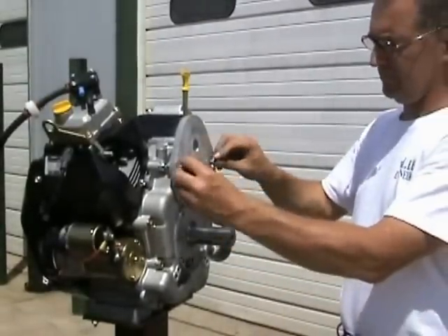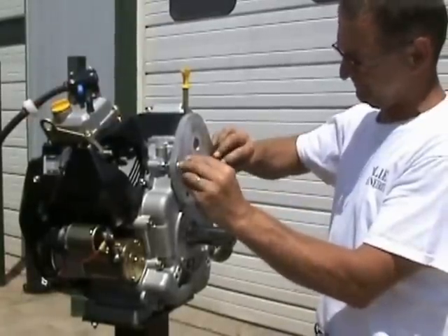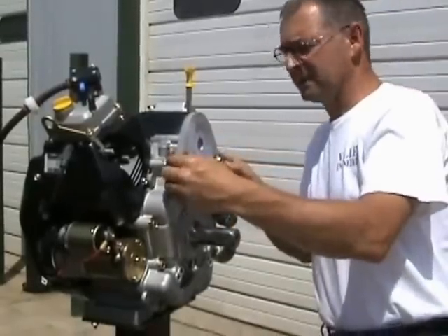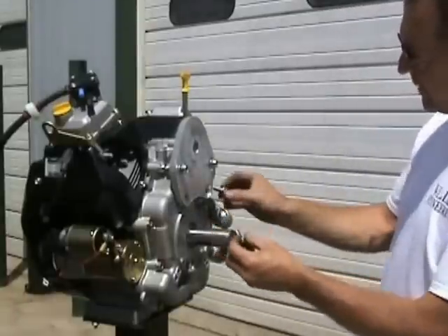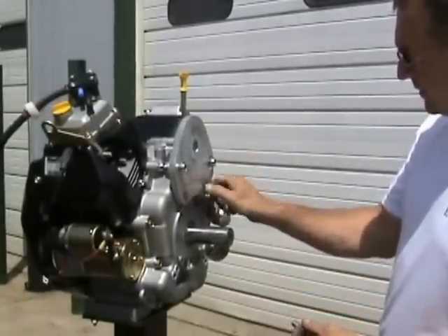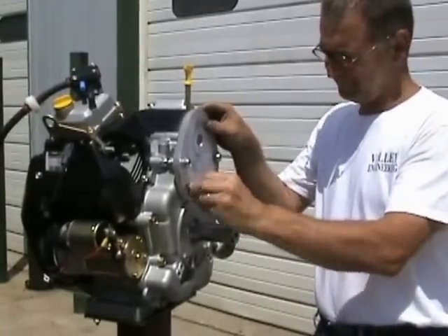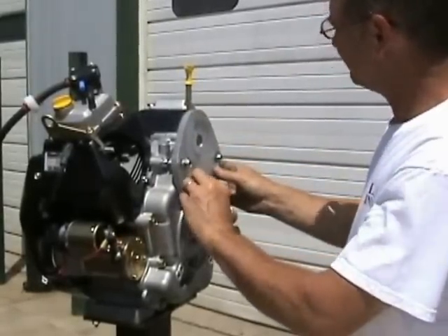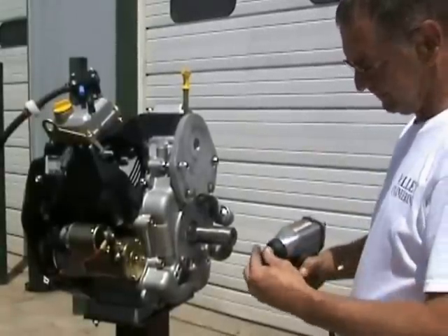Next step: another set of washers, and this time the locking nut's on the outside. I run the non-locking nut in a little bit extra so the bracket has plenty of room to flex. And you have two 5/8s that go on the bottom — the 5/8s with the head machined a little bit on the side that's fly-cut. The standard one goes in the other side. We're going to buzz those down to tighten them up.